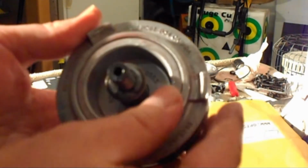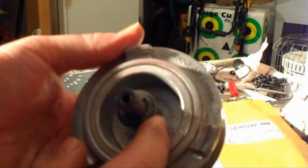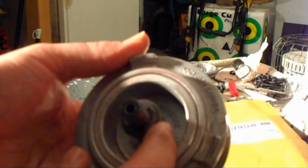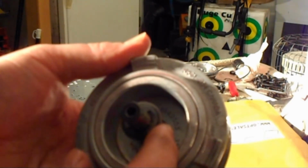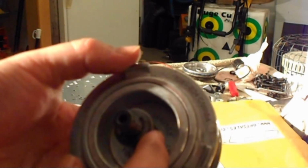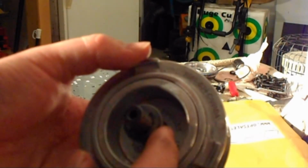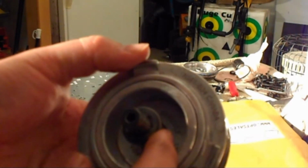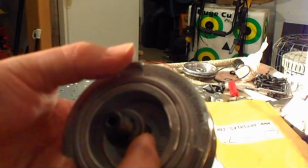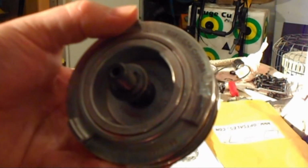Rotate this here. So right there, 553. You're going to use that number to drill one of the holes in your spacer plate, and with that it's going to be your 2-3 shift quality. So I'm supposed to drill it out to .070 to .076 on my separator plate, and that's outlined in the instructions when you're going to go ahead and drill out the holes.